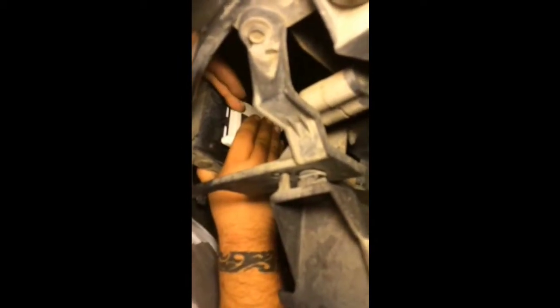There's a lot of stuff that I left out of this video. Obviously, you want to pull everything out of the box, hook it all up outside of the vehicle, put power to it, make sure everything works. It's super frustrating when you mount something in a vehicle and then it doesn't work. So I've learned over the years to test everything before you even bother to install it.